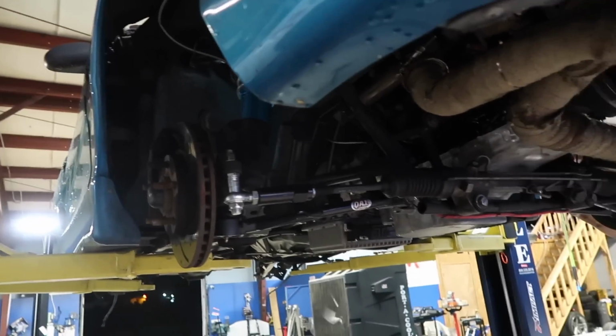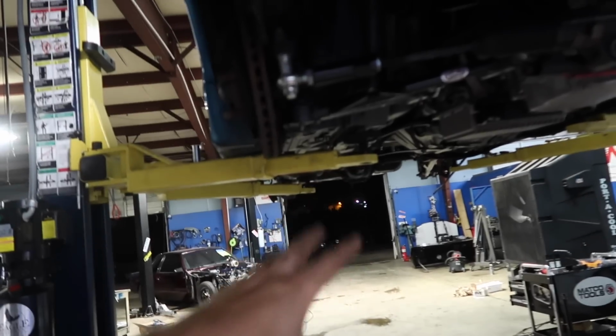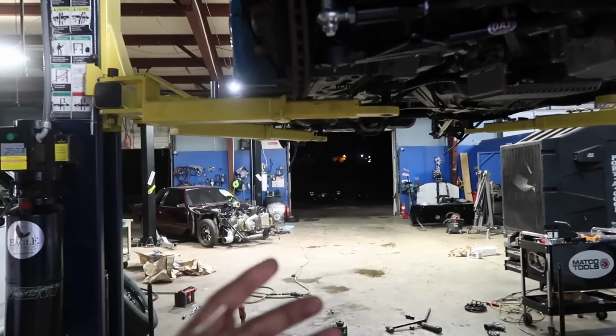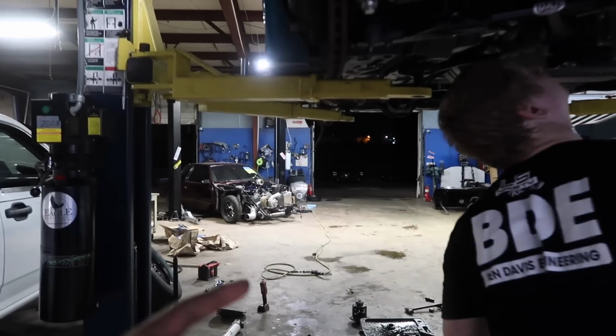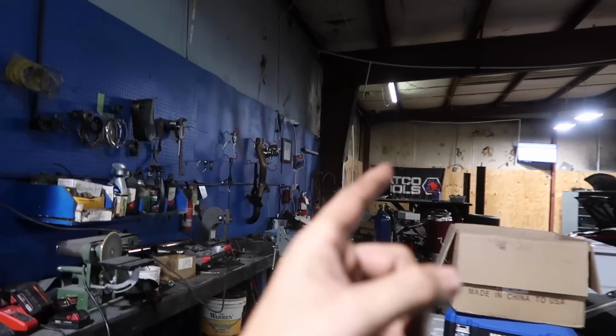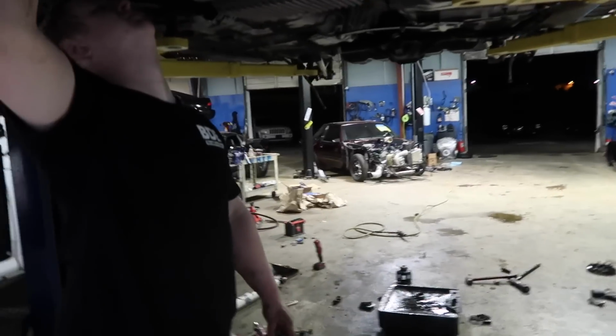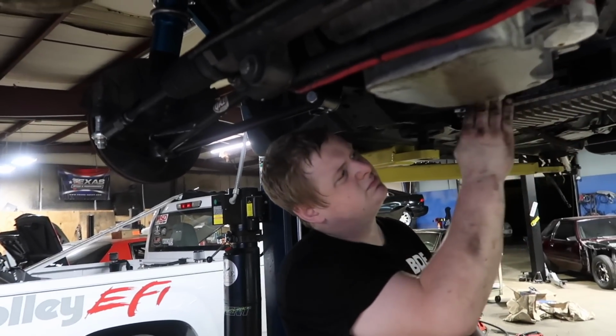Pretty excited about this. So tomorrow I've got to go get brake clean and shop towels so we can clean out the rear end housing before we install everything. And I've got to get gear oil. We have everything else to install it, so we'll get that thrown in tomorrow morning. And then to break the gear in, we'll put it right on the dyno and make some pulls and see how she does. I'll switch the wastegate out up here, and Ben will get that gear all set up. And it should set up pretty good, right? Yeah. Because it was already all set up before, huh?